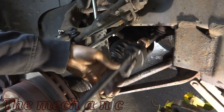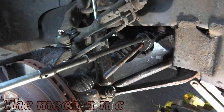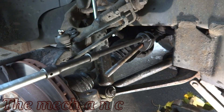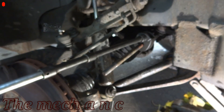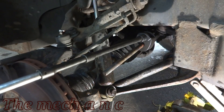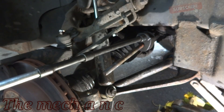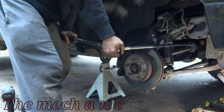I'm going to put it through its paces one more time. I have to do the other inner tie rod on the other side of this vehicle, and this time we're not using any heat or any previous method — so this is pretty much the first time any tool is going on here. We'll see how well it works with no heat. This should be a little bit more difficult, and I can tell you right now I'm applying a lot more force and this thing is not budging. The heat really does help. Naturally, inner tie rods are difficult to get off, but I have a trick — I'll show you the exact stance you need.